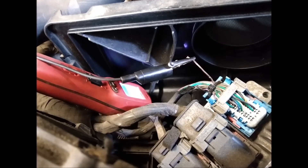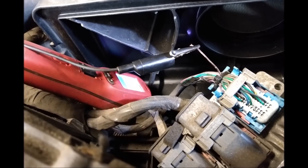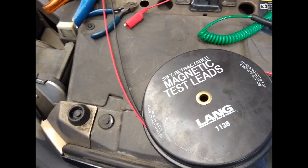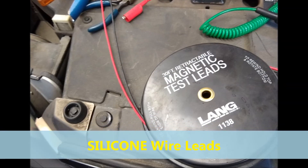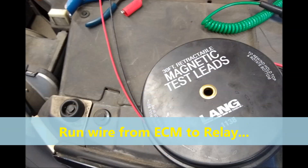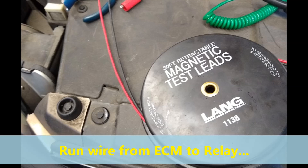Basically, what you do is inject some power on the relay side to make sure that you have power — just to confirm that's the correct wire. Of course, we had a wiring diagram and we went by that. In this next shot, you can see we have these leads. Leads are very important when you do diagnostics — you can buy them from a bunch of different places; the good ones have wires made out of silicone and are nice and flexible. We used this lead to run a new wire from the relay to the ECM, just to make sure everything worked. We cranked the engine and everything started right up.